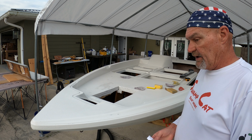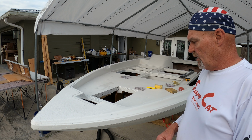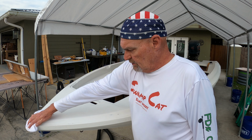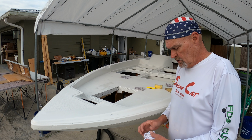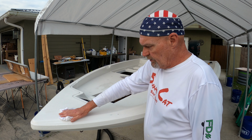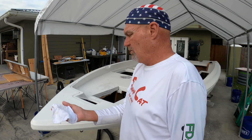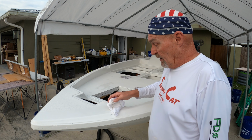I was planning on 3 coats of primer. The 2 coats covered it pretty well. I wanted to do a rough sand to see how smooth I could get the boat before I put the 3rd coat on. So what I'm going to do today, and I've got help coming this morning about 9, once this dew finally dries off and we can do some work on the boat, to help sand it,